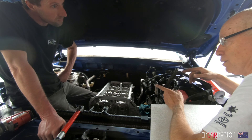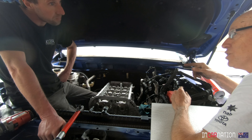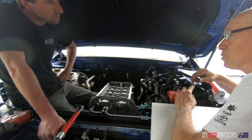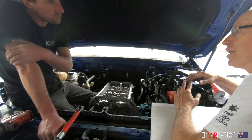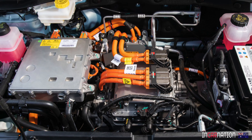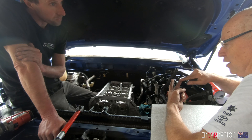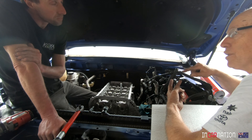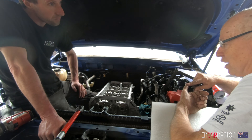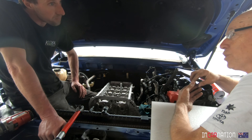With a bit of luck, the MG has high-speed DC charging, so we don't have to just charge from a power point or low charge rate AC — we can use DC as well, if we can figure out how to make it work. My thinking is we'll use as many bits out of the MG as we can: the DC-to-DC converter, the high-voltage cabin heating system, the electric air conditioner, the brake accumulators electric, and the DC and AC charging systems, because it's all designed to work with those batteries.